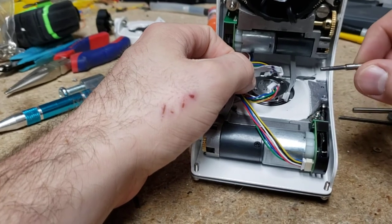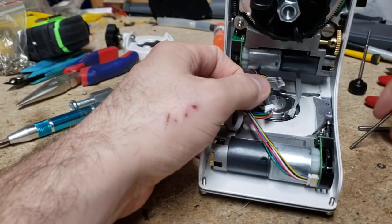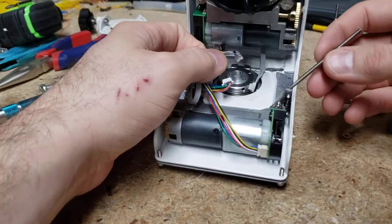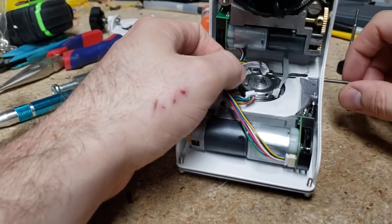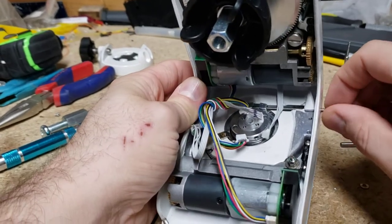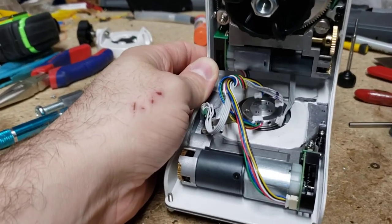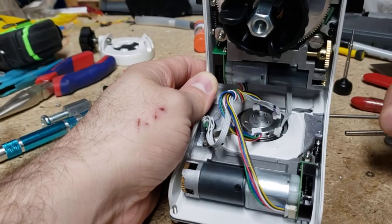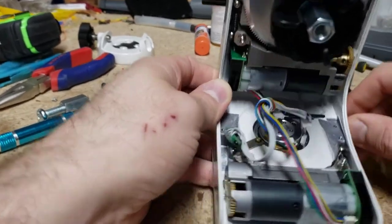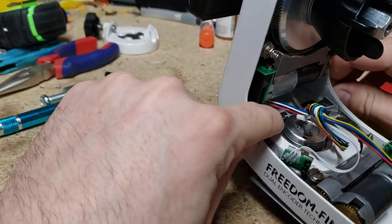Basically, I don't feel like ordering and waiting for another one of these just to strip it again, so I'm just going to set that aside. What I ended up doing was taking some M3 metric threaded rod and just chopping it to a certain length. Then you just thread it in there — it's a little tricky because it's not aligned. Let me put my nicer end in there. This is a little bit higher quality bolt, and if not, it's always easy to replace. I just want to screw it till it pops up on this end, so that's utilizing all the threads it can.